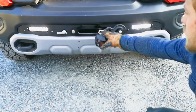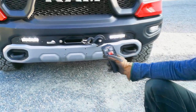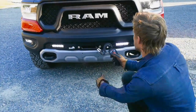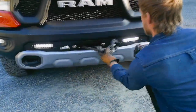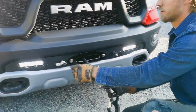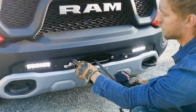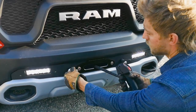We're gonna relieve tension off here to start, then we can free spool and hook up to something — just using the O button. Loosen it off a little bit until the hook's loose. If you've got our integrated winch clutch relocation kit, this just will turn.